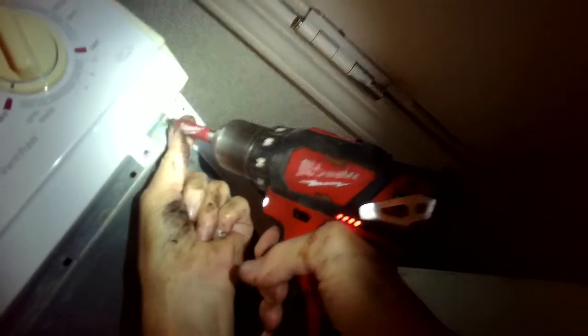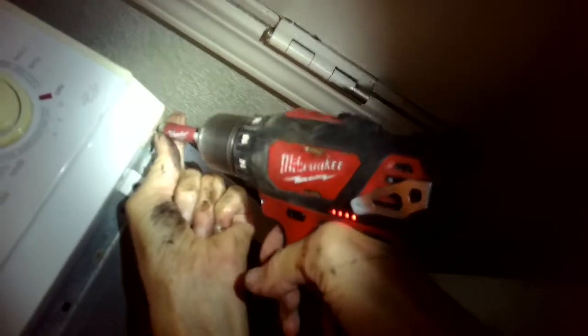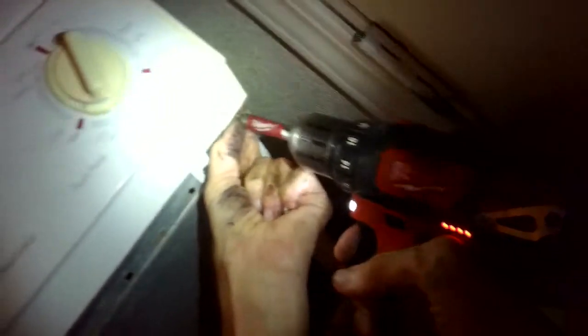We're going to be taking off the front panel of the dryer so we can get to the part in the back that's squealing, called the rear bearing. So I'm lifting that panel off and I'm going to disconnect it right here — that's the electrical connection.